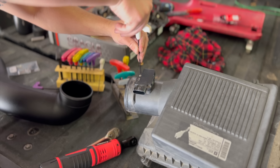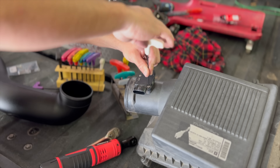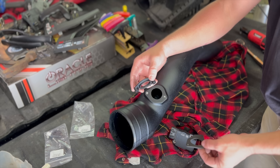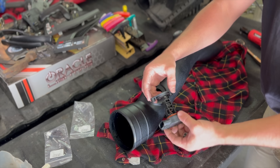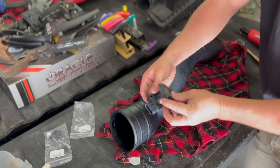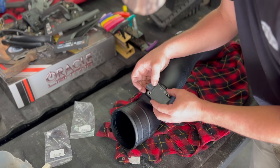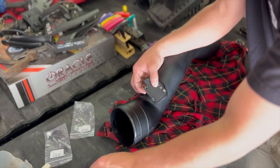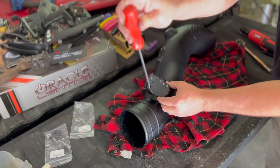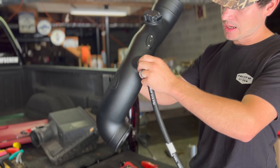Let's go ahead and get our MAF sensor off — be very careful with this thing because they can be sensitive. The kit includes what they call a pad and gasket for the mass airflow sensor. This pad will slip onto our mass airflow sensor and they can both only go one way. This should line up just like that, and then this should install with the arrow pointed up the tube. It does come with new screws and a tool. Actually, the tool is to take your factory one out. There we go — should be perfect. I definitely didn't think the hose was going to slide on that easy, so I'd recommend installing it before you do this step.